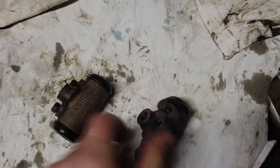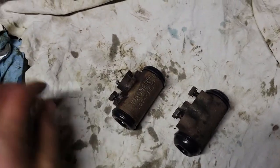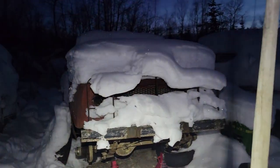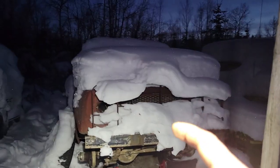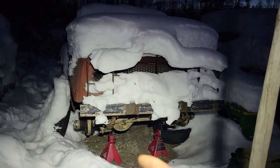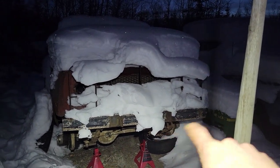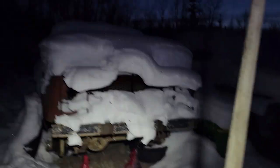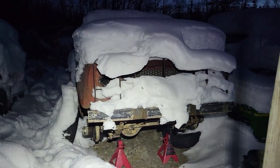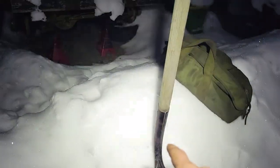Just like that, our old wheel cylinder should be good to go - with the exception of that bleeder that I need to find. Now I need to mosey on up to the Red Parts Scout and have a look at the front wheel cylinders, and see if I can't make those work. It was probably a month ago that I put this thing up on jack stands and took the wheels off, getting ready to pull brake parts off of it for the other Scout - and well, as you can see, I never quite got to it. The brake drum on that side has a stuck flat head retaining screw in it that needs to come out. I brought my little tool bag, and we need to snag the wheel cylinder - I'll probably just take everything off both sides.